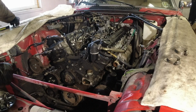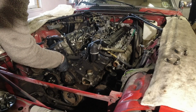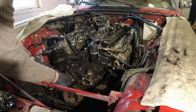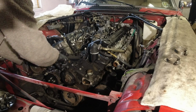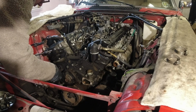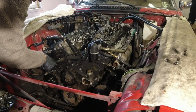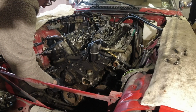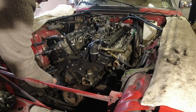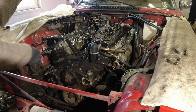Now I remember why I can't use a socket everywhere. It's here. The water pump is really wide. It goes all the way to here. So you do need to remove this one as well, the whole hub assembly for the fan. And that is a little bit of a tighter squeeze. But we're very close now.